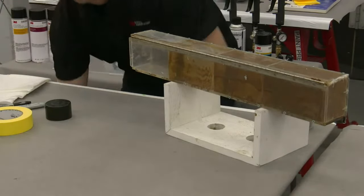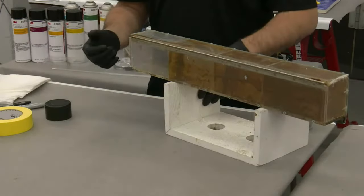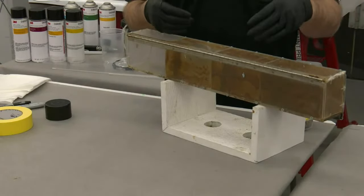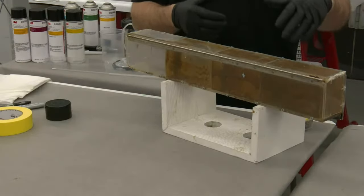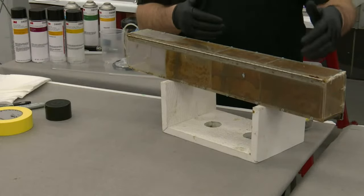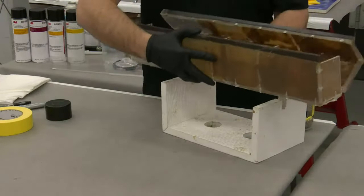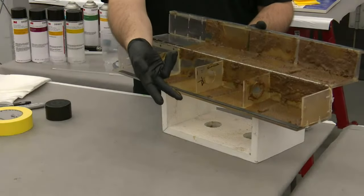So now 3M recommends three coats with our product. And the reason why we recommend that three coat application is simply because a lot of OEMs, Subaru in particular, have a minimum rating as far as how much cavity wax needs to be applied in each and every repair, including door panels, but how much material needs to stay on that surface for the life of the vehicle. So while the customers are driving around, they don't want it to be running out and dripping all over the place. But that foamingness I had mentioned, okay, this is designed for a reason.